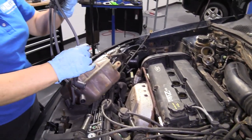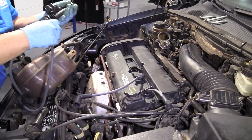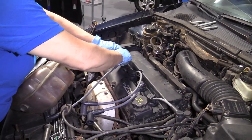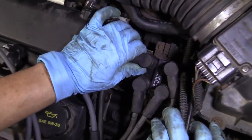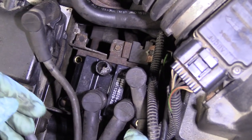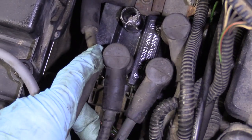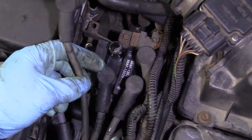The next one — this is the shortest one — and I'm going to alter the angle of the plug wires. And cylinder one. Now we're going to go over to our coil, and this one has been marked for us, which is nice. If you didn't have one that's marked, then mark it on a piece of paper. Some people put a Sharpie on the back of the wires, follow it and trace it — place one, two, three, four. See how it says four here and two there. They marked it with lines, a single line there.